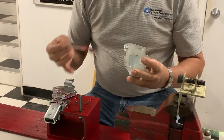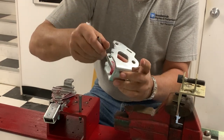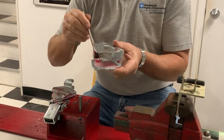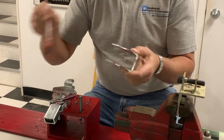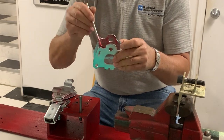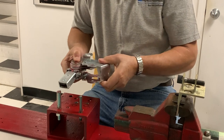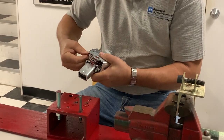This plate is going to go up into here, and there's a little bit of corrosion. What I like to do is smear on some lube, some grease — that'll keep any rust from forming now that it's back together. Get it lubed up around where the carrier is going to rotate. Now I'm going to slide all of this together. The bow tie has to be out of the way; otherwise it won't slide in.